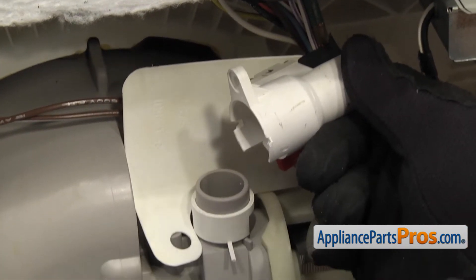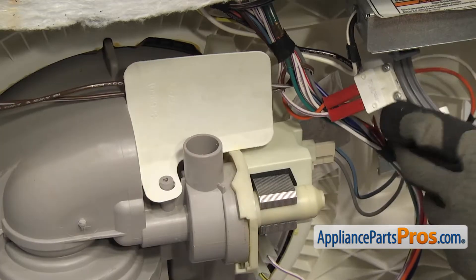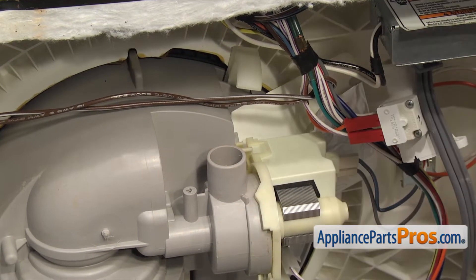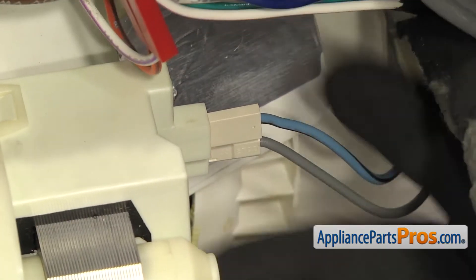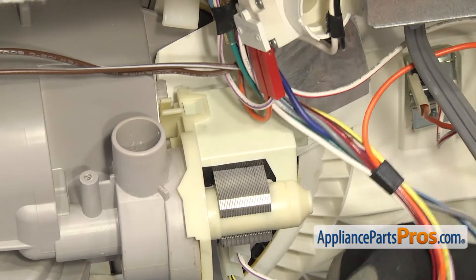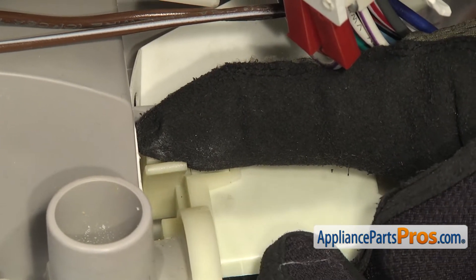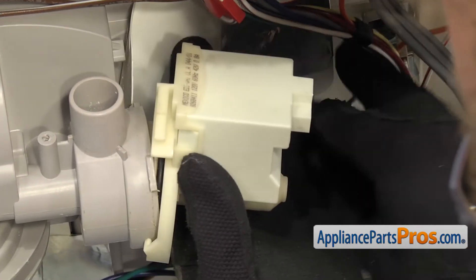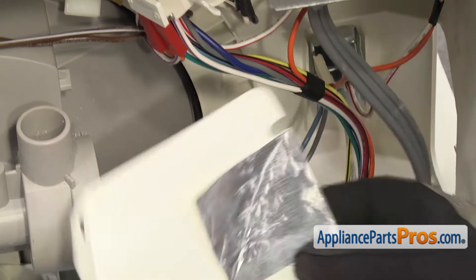There's an o-ring and this plastic piece right here that has to come off also. Once you have the fitting off, we can just lift the shield out and set it aside. Now we can take the wires off the drain pump. There's two wires on the back of the pump — a gray one on the bottom and a blue one on the top. All you have to do is unplug it and get the wires out of the way and then we can take the drain pump off the sump. To release the drain pump, there's a little locking tab right here that we have to press down on. Once you have it pressed, you can turn the pump to release it from the sump. Once you have it off, you can pull it off and set it aside, and then this little key shield is going to come off also — just lift that out and set it aside.